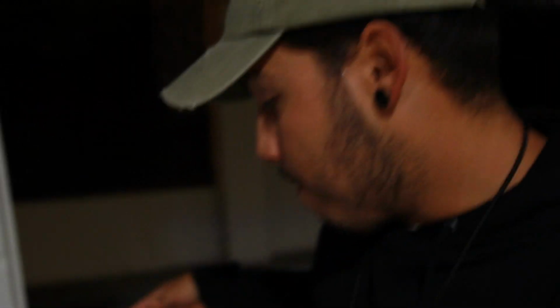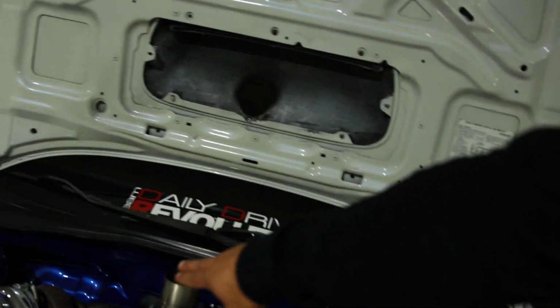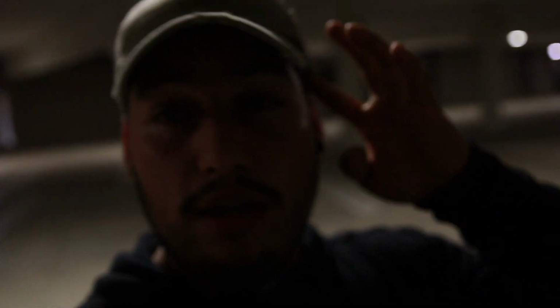For my brakes, I got rid of my ABS, so I got a thing from ChaseBays. It's a proportion valve, I believe. I had to run 2 lines from there all the way down into my cab, and then 2 lines from the back were stubbed out right there, so I had to cut them. I had to flare those lines myself so they can connect to the actual fittings that ChaseBays sent.